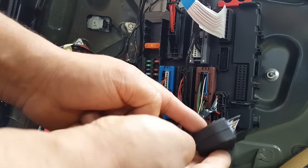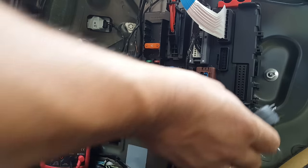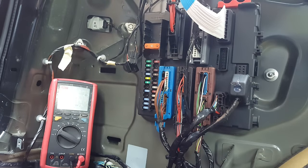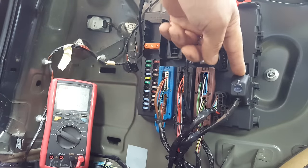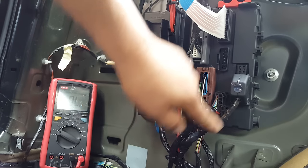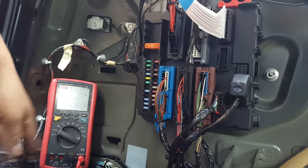So all I've done is, this plug, there are wires that go onto the original car loom using this method, taking the current, and then you plug this in there. Job done. So basically what is happening is the current is coming through here into this plug, okay, and this is taking the voltage from the other circuits, comes through here, goes into the correct pin, which in turn goes inside the rack, comes back through the original plug and goes into the tow bar.